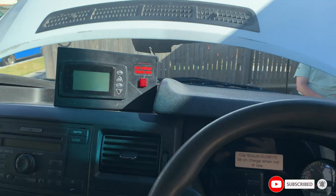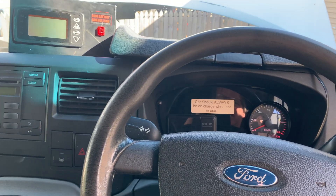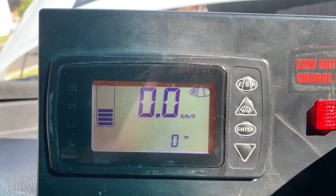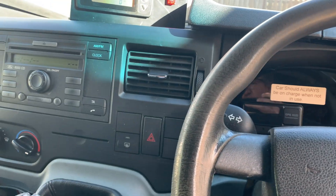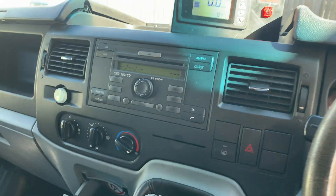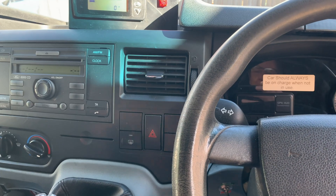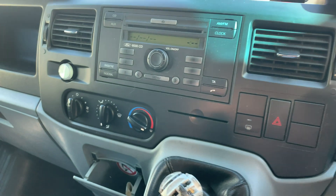Having a second look inside the car when I turn the ignition on — the battery has got a few bars on the gauge now. We are coming up very slowly. Nothing more seems to have changed on the dash. The radio works as well. There's still a parasitic draw on the battery — my brother mentioned the car was off all night but lights were still on the dash, so I'm not sure what's going on there. That green light corresponds to the charger underneath the car.